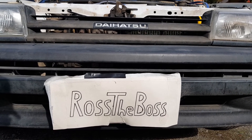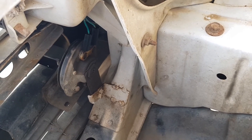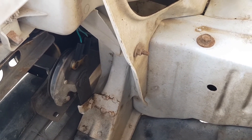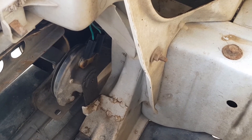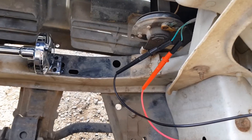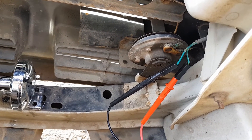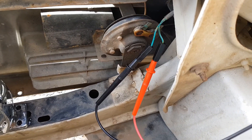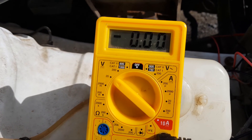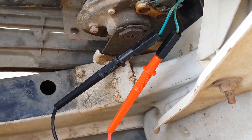Okay, now that the horn and the little motor are in place we have to connect the two. I'll be using the original horn wires just to keep things simple and the wiring neat. We just need to figure out which is positive and which is negative, and to do that I'll be using a multimeter. So I've stuck the positive in one end and the negative in the other — this will help us determine the polarity. I'll push down on the horn and see what the multimeter tells us. Okay, so that was giving us a negative reading, which means the black one is positive and the one the red probe is in is negative.